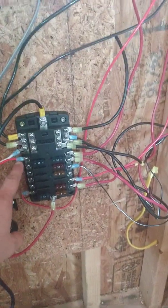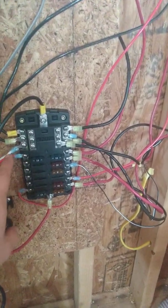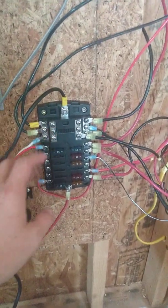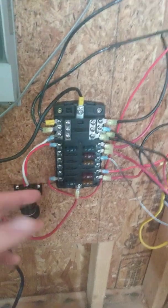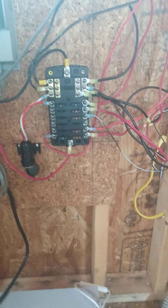That's nice so that if you have an issue you can isolate it, rather than having everything on one circuit — if you have a break anywhere in that circuit you're screwed. Just as a little example, I have this little charger; something like this would go in just to charge my Milwaukee batteries or what have you. You have your positive here, 15 amp fuse, negative here. If I pull this fuse this circuit wouldn't work. And if it does still go over 15 amps, boom — this would pop and protect the circuit, protect the components.